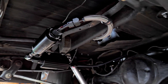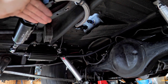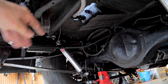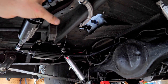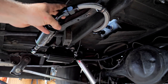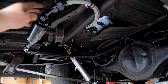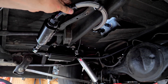One thing I want you to notice — I see a lot of people don't do this: the pump filter and everything from the sump should be at the lowest point and behind everything, so when you accelerate all the fuel is pushed to the pump. I know some people put pumps above this or over in the bed, but that's not where you want it. As long as you put everything behind your sump and below it, you should be good to go — that's just my experience, and I've had problems doing it the other way.